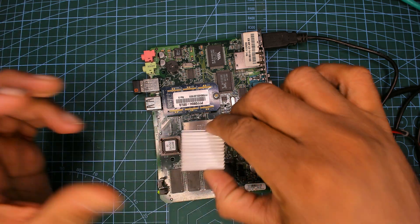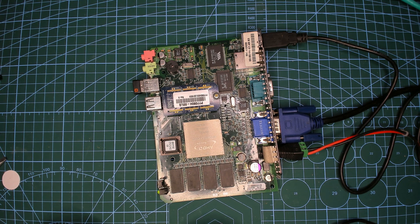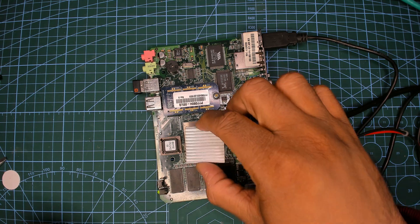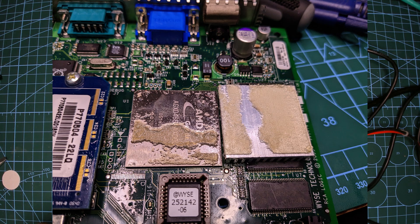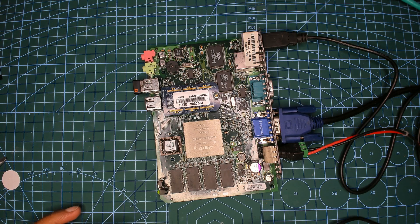Here's the heatsink it came with — it locked right on top like that and was glued hard. It was a very resin-ish but fibrous material and I couldn't get it off. When the heatsink was on the CPU, it would get really, really hot — it was reaching higher temperatures with the heatsink installed. The reason is the thermal interface material was absolutely crap. That thick, glue-ish, fibrous thing is around 1 to 2 mm in thickness, so it was heat soaking without properly transferring heat onto the heatsink.